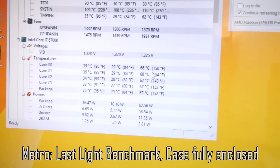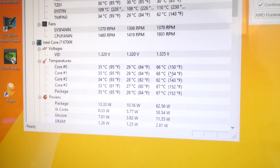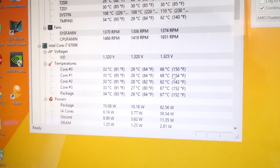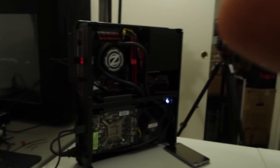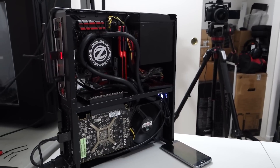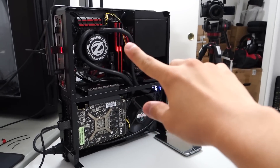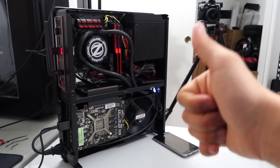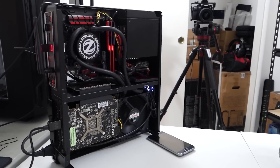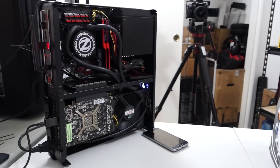Max temp on the 6700K — we got 68 degrees Celsius. Well below 70. That's very nice because this is overclocked to 4,400 megahertz. If you guys remember from the testing video where I tested this with the Noctua air cooler, temperatures were in the mid-eighties — I was getting like 83 degrees Celsius with the 6700K, the same chip, with turbo boost disabled. And now here we are at 4,400 megahertz, chilling at 68 degrees. That is quite an improvement overall. I would call this project a success.